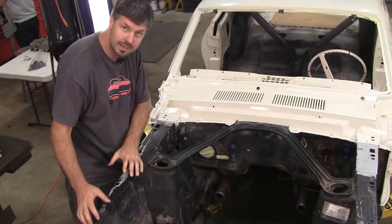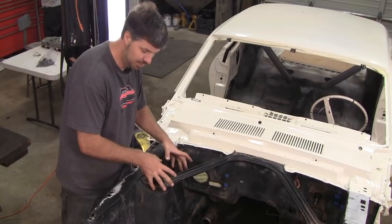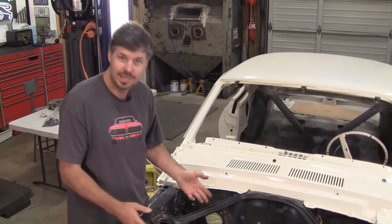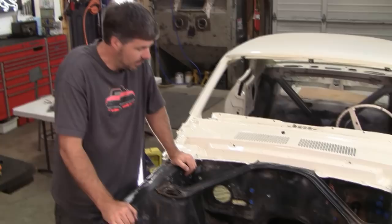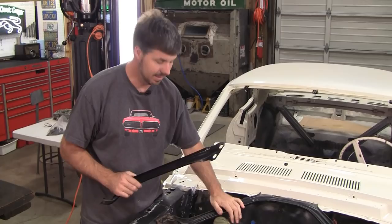It does something else too. If you get in a minor accident, your crush zone is going to be in here more than here. This is expensive and hard to replace once the shock tower gets pushed back and wrinkled. So this makes the car not only handle better, but I think it makes it safer. When we're talking export, the Europeans said you can't send these cars over here — we drive fast and our roads aren't as nice as yours. Even the six-cylinder cars had these export braces when they went over there. So even if you're a purist, I would think real seriously about putting these on.